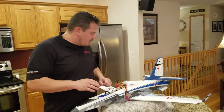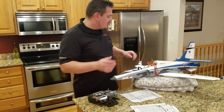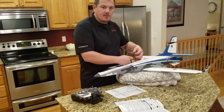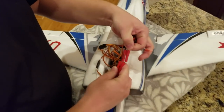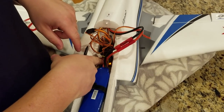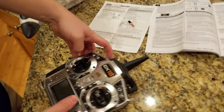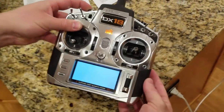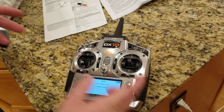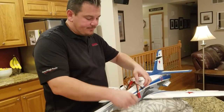Throttle cuts on, plug it in - watch for the spark. See the flashing? That means we're ready. It keeps beeping - pull out the bind switch or bind plug, then hold down your bind switch, make sure you're a meter away, then turn on your power with the correct model already selected. Bind failed - okay, so we have to start again. That's definitely the bind point though.